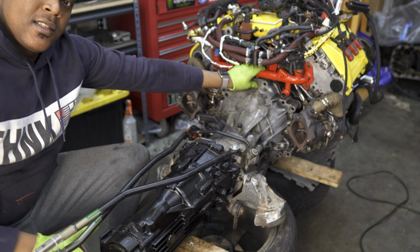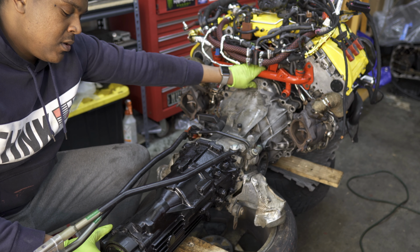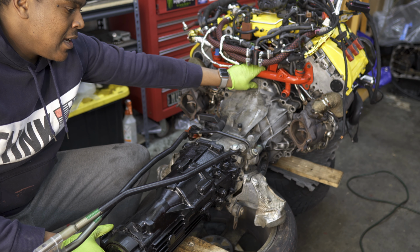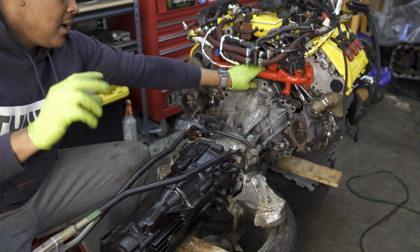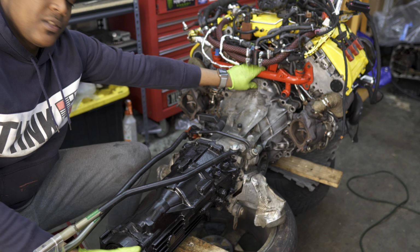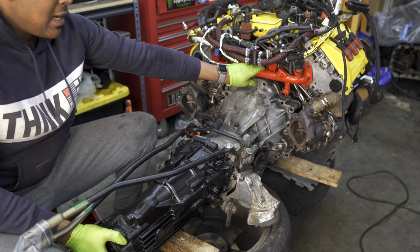If you see that this is still not working, this is when you go ahead and grab that bolt near the end that I showed you earlier and spin it slightly. That's hopefully to rotate that input shaft a bit and get it to match up with our clutch. And then just go ahead and push and wiggle until you get everything lined up correctly.